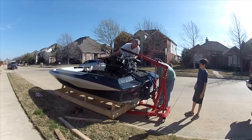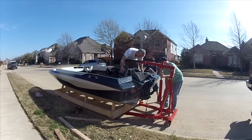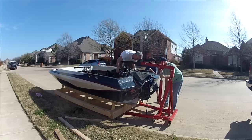The idea is you install your transom assembly, you drop your engine down in there, you bolt the rear mounts down, not super tight, but you get them fairly tight, and you use the engine hoist as your front adjustment. You take your alignment bar, slip it in through the gimbal ring, you get your engine somewhat where it needs to be, where it slips in, and then take your front engine mount measurements. Once that's done, you can take the engine back out, get your engine mounts built, and then move on from there.